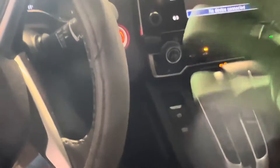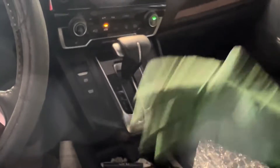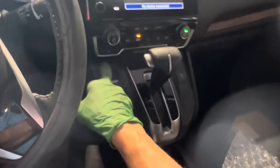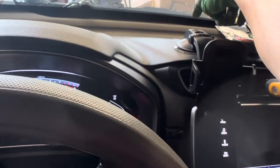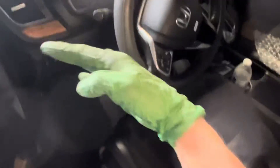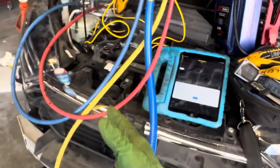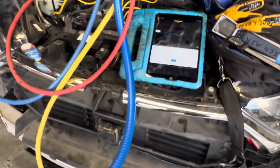If you have an interior temperature sensor — look it up in your manuals — sometimes you'll see a little square or round opening somewhere, sometimes underneath, with a little grill. Flash your light and you'll see a little bead in there, a probe that looks like an ambient temperature sensor. Some have humidity sensors too. Blow your breath or use a hair dryer pulled way back and try to get a temperature of, say, 110 degrees — pretend the interior is desert-hot. Heat up that temperature sensor, put a strong sun load light over the sun load sensor, and with your scanner hooked up you'd see the duty cycle to the compressor control valve increase, putting a high output on the compressor — and then you'd see your pressures go up. That's a way of tricking some cars.